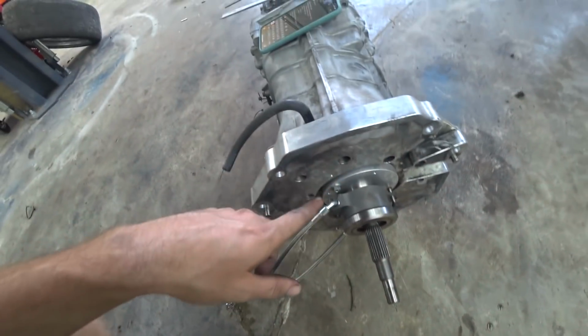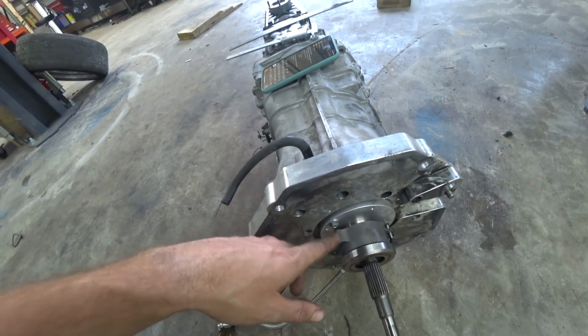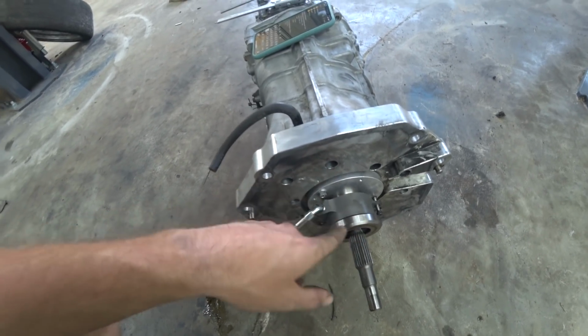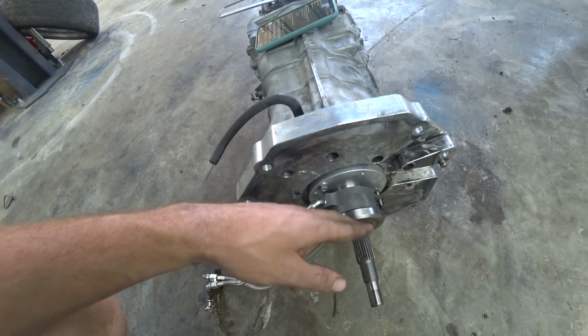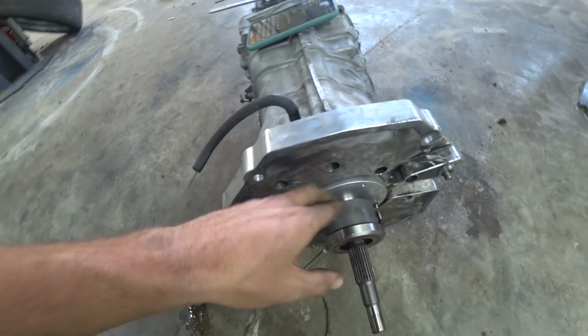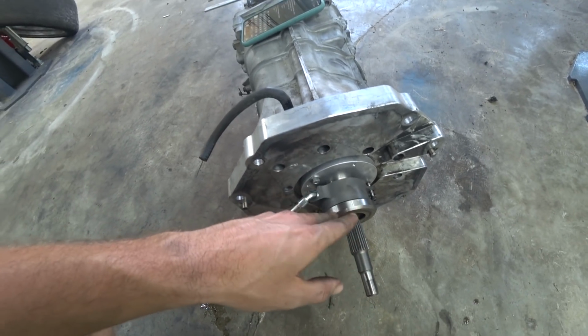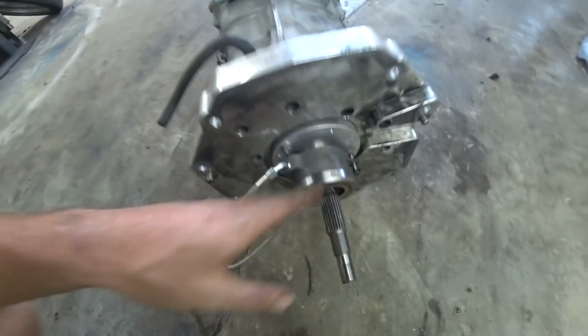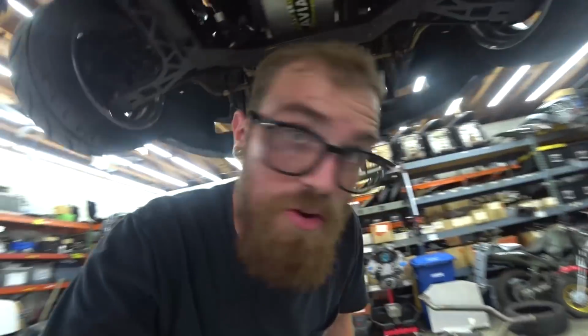All right, so I did some more measuring, and basically right now this is a millimeter too long, not counting the 3 mil air gap we need. So in theory, it's adjusted 4 millimeters too far out. I'm going to try to adjust it in and triple-check everything, and I've also got some other avenues I need to investigate as far as the problem, but that is the problem. It is just a tiny bit too long.